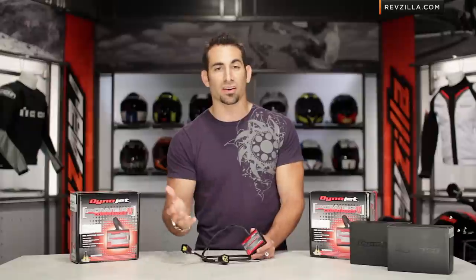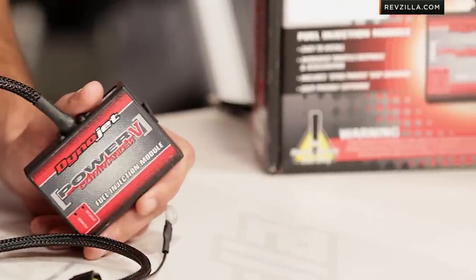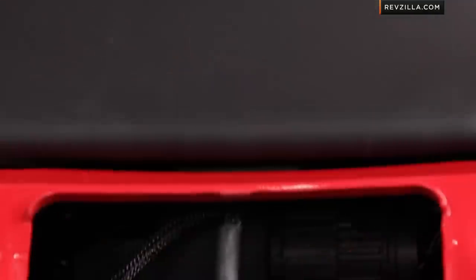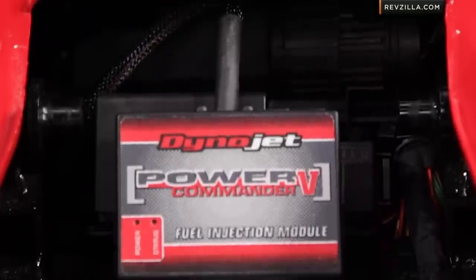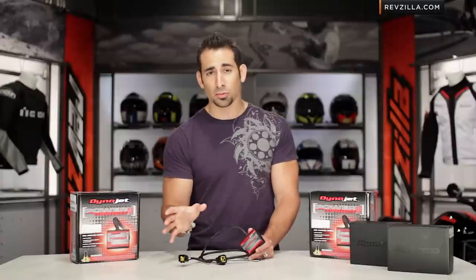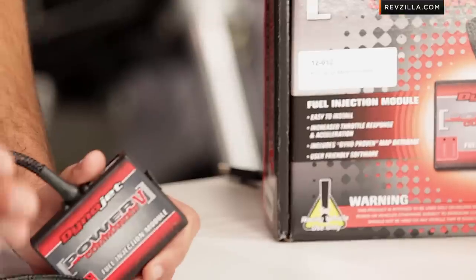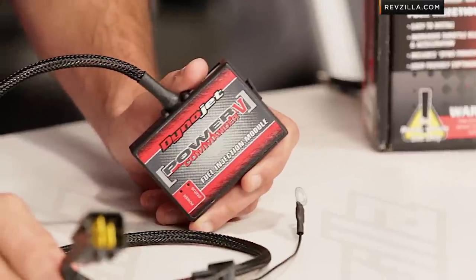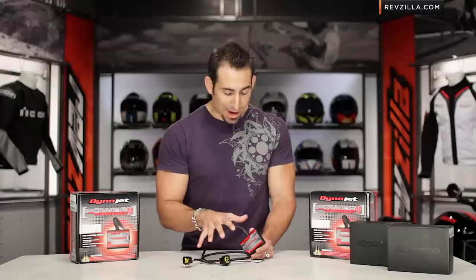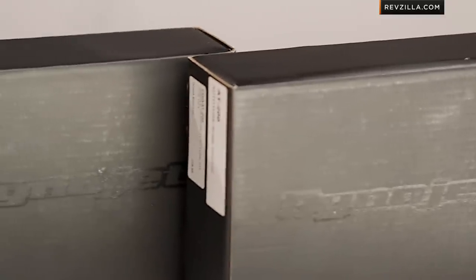On this R6, there are really only two plugs, and depending on how comfortable you are taking off the fairings and getting to your engine, with a complete tool set in your garage and a six-pack you can do that on a Sunday afternoon. Now if we were talking about something like an S1000RR, there could be eight different plugs — four cylinders, two injectors per cylinder — with a lot going on on both sides of the bike. If you're that comfortable of a wrench, go for it. But if not, you can always buy your part and take it down to your local shop — especially on sport bikes, they do these all the time.